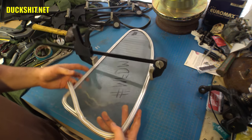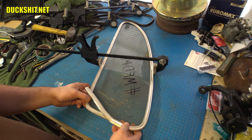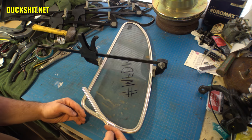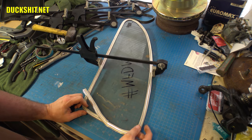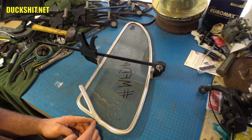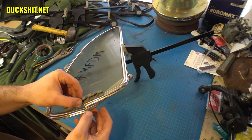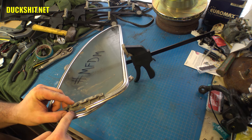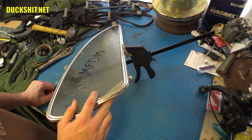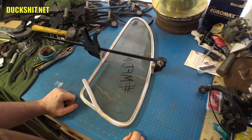And then what I will do to finalize this bend is I will move this one out of the way and then close this up and then try to join the two together. And I'm going to leave a little excess material on in the middle, because if they close tight and the glass feels loose, then I'll just shave them out a little bit and get that straight. And then once that's good, I'll screw in my bracket, which should give me my template holes over here, drill out these holes, tap them, screw it in, and it's ready to install. And we'll see how it fits properly on the vehicle.